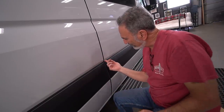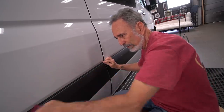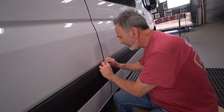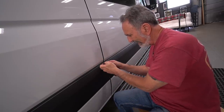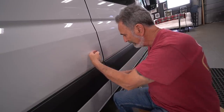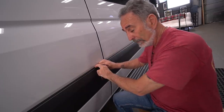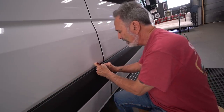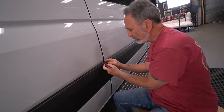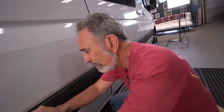There's another issue here. There's a little crease in the body panel in the white part — there's a little ledge. So once you have this whole thing in, I'm thinking if you can get that edge of the rubber to rest under and behind that crease, you've created flashing. Now the water doesn't even have a chance to get back there — it's going to just drop right past it. There's compression when you press this in there, so that compression is sort of sealing this whole top edge. You can get a corner of your dash tool underneath that folded edge and just run it right in.